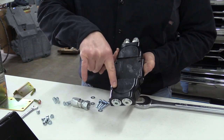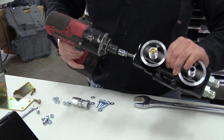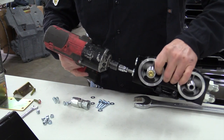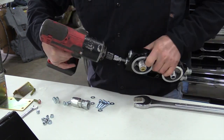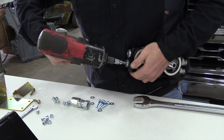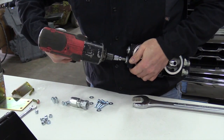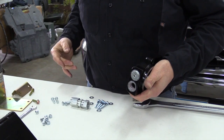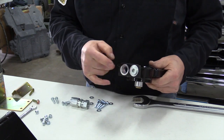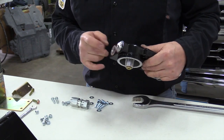The first thing we're going to do is take out this plug on the arrow coming in — that's a 5/16 hex. For some reason, AMSOIL is having them put permanent Loctite on, so they tend to come out fairly tough. I usually use an impact with a reducer on to go down to that 5/16. That opens up the port for my oil sample valve — that's where it's going to go.